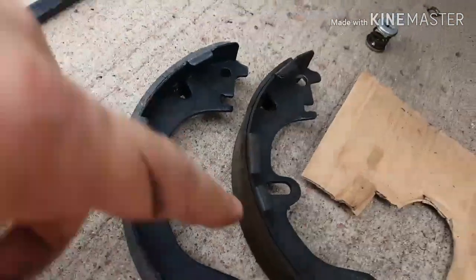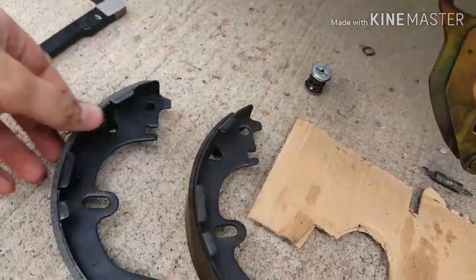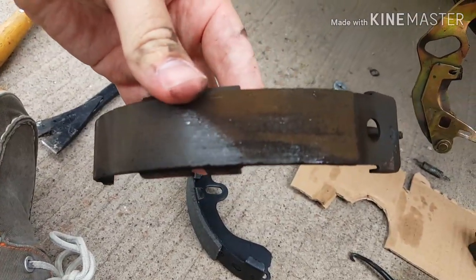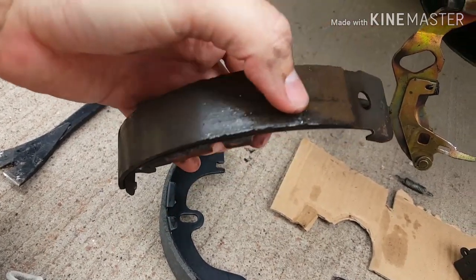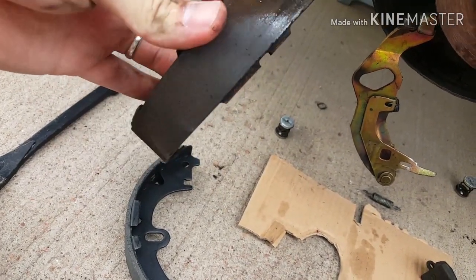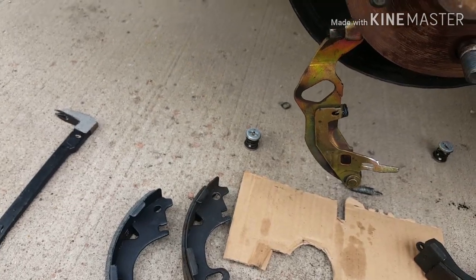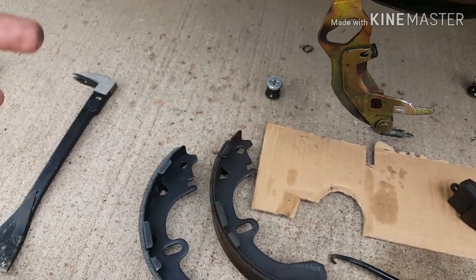Now you can compare your old brake shoe to your new one — old one on the right, new one on the left. To be honest, there is not a lot of material difference between them. The main reason I'm going through with this is that brake pads aren't that expensive, and also you can see it hasn't worn properly — there's really no wear through a certain area. Since it was already a giant hassle to get in here and my brakes weren't working super well — feeling like they were slipping — I wanted to check everything. My fronts obviously needed it, and since I was already in here, I might as well just replace the rears too.